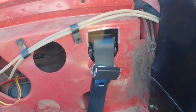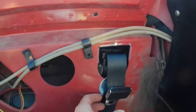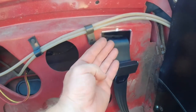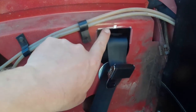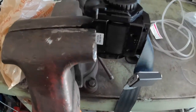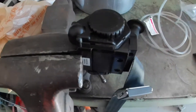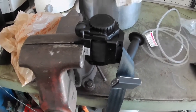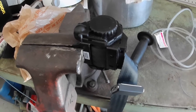So that didn't work out quite as well as I had hoped. When I tightened it down, that mechanism pulled back a lot more than I want it to. So I'm going to pull this mechanism back out, get a look at the bottom of it, and maybe put a little bend in that metal down here because I want the top of that thing to come out. I don't like how it would rub on those hoses and this edge more than I'd like to see. You can see how I got it in the vise there — clamped it down and just kind of gave it a little pull. It didn't take much; that thing bent a little easier than I expected. I don't want to go bananas and weaken anything or change the geometry big time — I just want to make a little clearance.